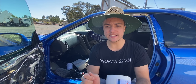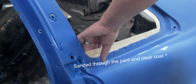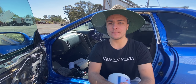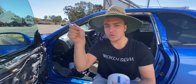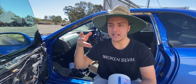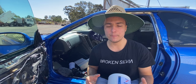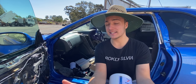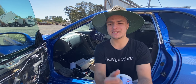So when I was sanding the car, obviously edges are always the easiest to rub through. I've rubbed through the clear coat, I've rubbed through the blue, and we've gone into the white paint. Which means if I were to spray it in solvent, to make sure that we don't get any reactions, you would grab your gun, you would feather over your blue base coat, and straight away you would just hold it so fresh air comes out and flashes off the paint before spraying the entire panel. Now with waterborne, because it doesn't have thinners in it, you don't have those issues. You just spray the thing and it turns out mint.